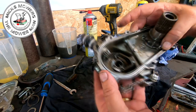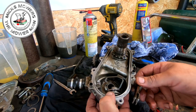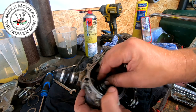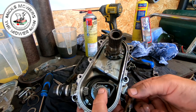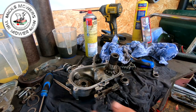So I've got to take the clutch fork out and then order a new clutch fork and also order a new clutch. That's why the clutch wasn't working, because obviously when it went into its little tiny home of which it lives, that part of the clutch there wasn't lifting up, you see? So that'd be the reason why she died. So let me get the parts ordered up. I'll show you where I've ordered them from. I'll be back to you in two takes of a cat's whisker.